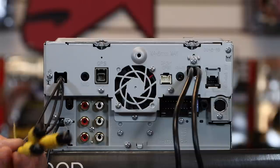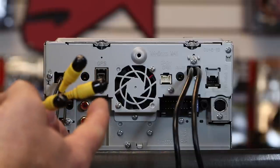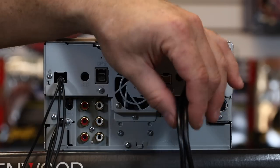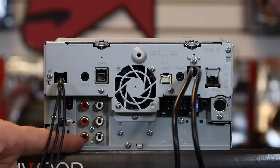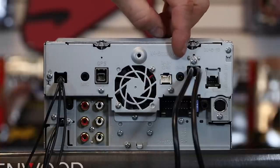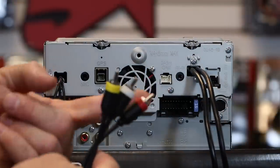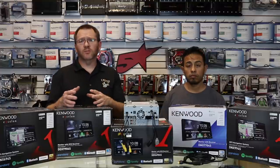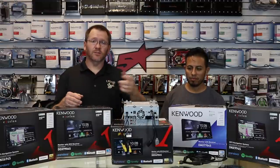On the back of the Kenwood radio you're going to have what look like AV inputs. What you have is a front-facing camera, a rear-facing camera, and then a video out for a rear screen. Over here you're going to have some USBs and your preamp level outputs to go to your amplifiers. What you're looking for is this guy right here — on the radio it's going to say AV in, which is an audio-video input. Kenwood builds the radio and obviously feels they don't have enough room to put a full set of RCA outputs on the back, so that's why they just give you the aux.